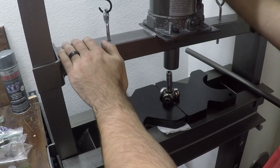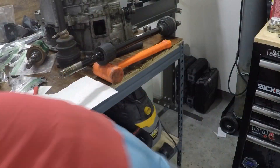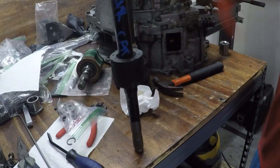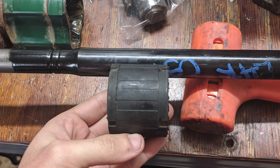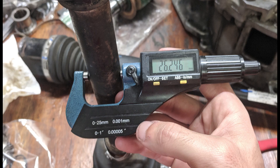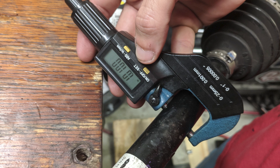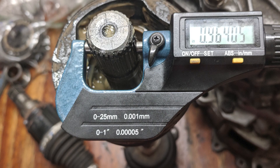In some cases you need a press to get these apart, but it's really not a big deal. I probably could have used a mallet, but if you've got a press, why not? Now, this has a little harmonic damper on here just to balance out any imperfections. These are the two ends that I need to mate together. We're taking measurements here — we've got just over one inch on the DSM axle, that's 26.246 millimeters, and we've got 1.01 inches, just over 25.6 millimeters on our Mini SUV axle bar.